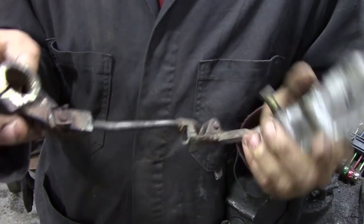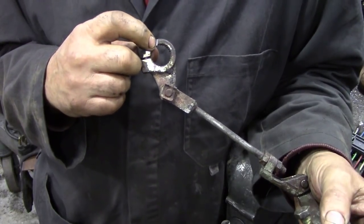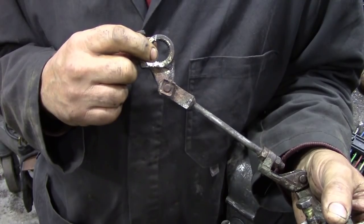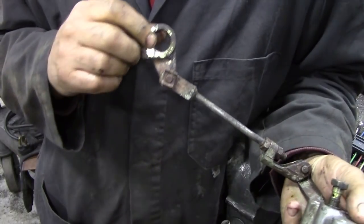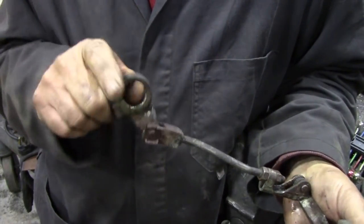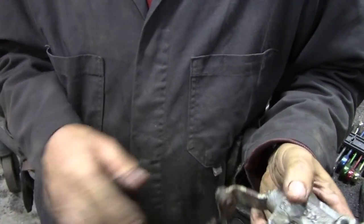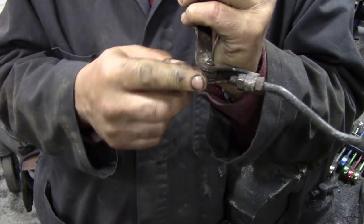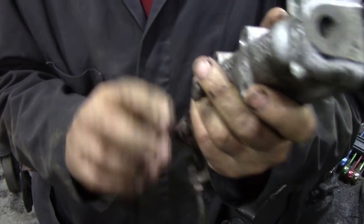One thing I wanted to show you is when I took this off the car, I just got a little slitting disc and slit down the side of the end of the shaft that goes through your little high-low diff lock thing. So I've got a mark on here so I can put the spline back on in the right place — makes life a lot easier. So all I'm going to do is put these on the vise, punch them through, and then clean up the bushes and the pins with a wire brush.